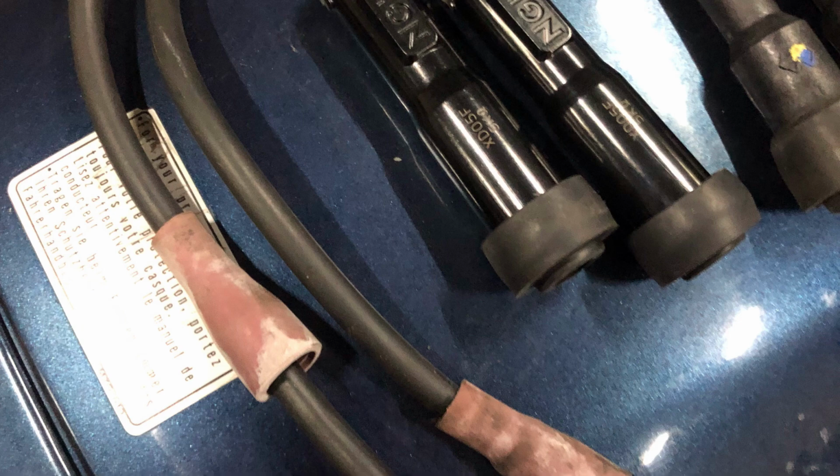There they are on my fuel tank, well, plastic fuel, it's a dummy fuel tank on the Honda Pan European, all lined up for their little beauty pageant of photos there. And as I say, you can see on the NGK ones the 5k resistor. Now the next few photos will show how to remove that resistor and effectively bypass it. It still leaves a 5,000 ohm resistor in the plug, and that's more than enough to stop your neighbour's telly going off funny, or radio sounding weird.